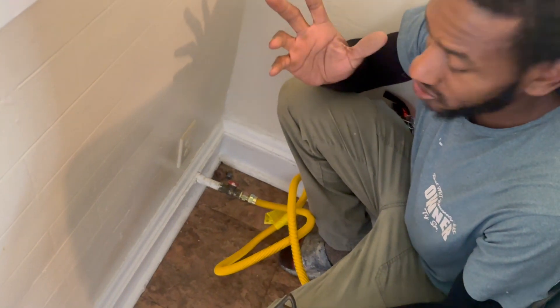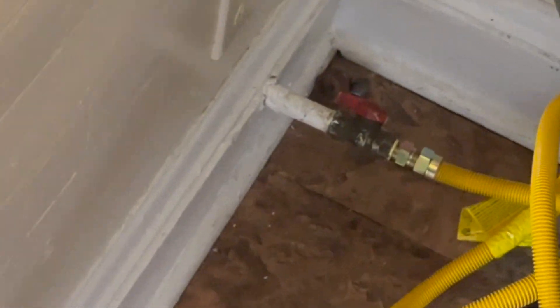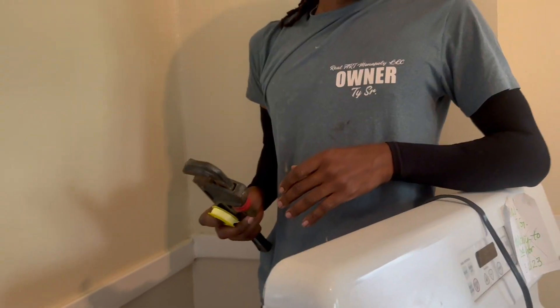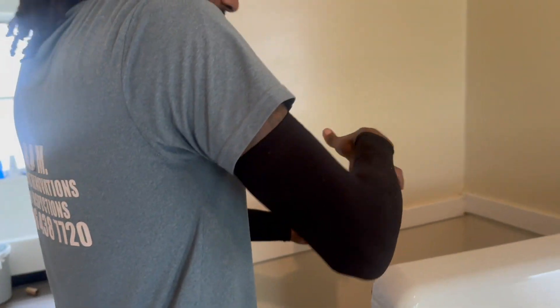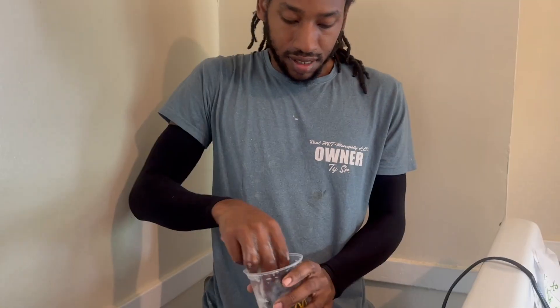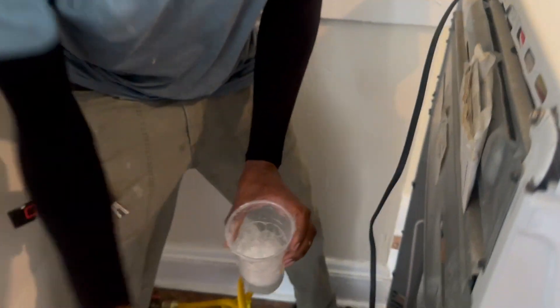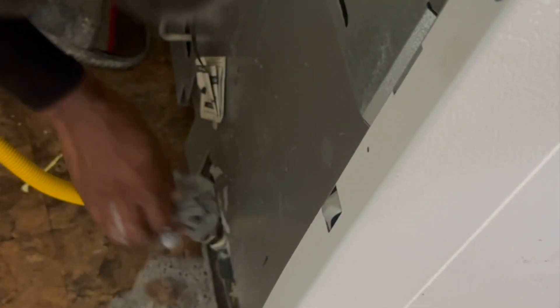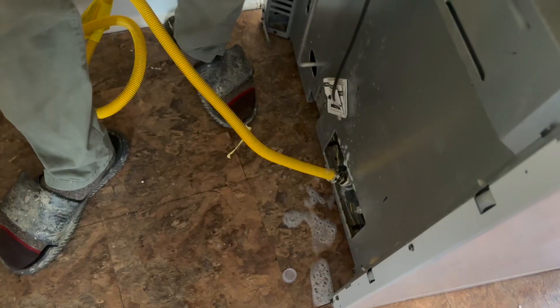Everything nice and tight — now you can turn your gas on, get some soap and some water. That's how we're going to actually check to see if the gas is leaking. I'm going to go ahead and turn on our gas valve here. Another way to check: if you smell gas, you might smell a little when you first turn it on from the actual stove itself. We got a dish right here with some soapy water. You grab the rag, nice and soapy, ring it out around your connections. If it starts blowing bubbles like you're chewing gum, there's a leak. That one looks good.